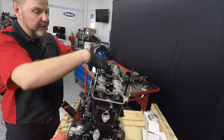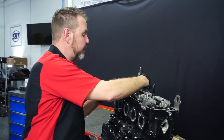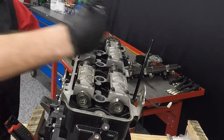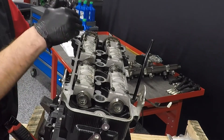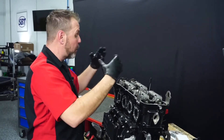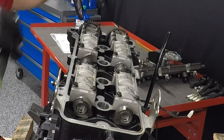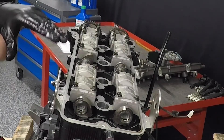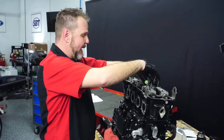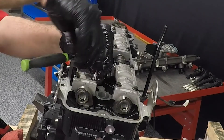When taking these camshaft bearing and retainer assemblies apart, make sure to pay attention to your orientation. This one is stamped EX — that is your exhaust camshaft. IN is on this one — this is your intake camshaft. If you can't quite remember the orientation, take a picture. You also have arrows pointing to the front of the engine, because that's the way this needs to go back on during reassembly. All of these surfaces are mated to each other — this camshaft, this block, and this orientation on the actual cylinder head. Incorrect orientation could change the oil clearance to the camshaft or even damage it and wear it out much quicker than it should.